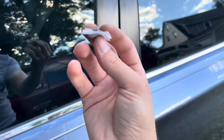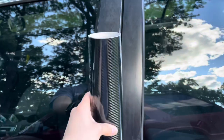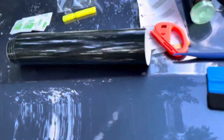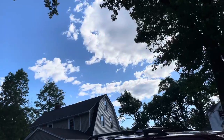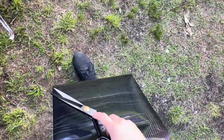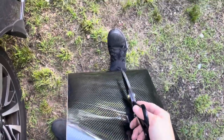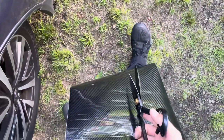I just cleaned off the other one — this is what they look like now. Once the alcohol has dried, you're going to want to cut the length you need. If you're doing carbon fiber, make sure you go with the same pattern and keep it consistent — otherwise it'll just look weird. I already cut it away from the rest of the roll. People use a heat gun for this, but I'm not using one right now. The sun is blocked by clouds, but you can use the heat gun to stretch the wrap if needed. I'm just too lazy to find an extension cord.